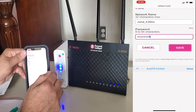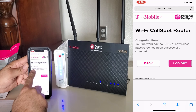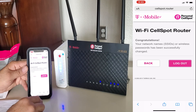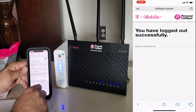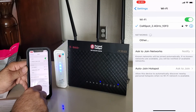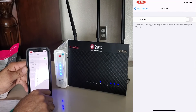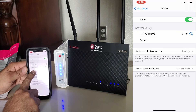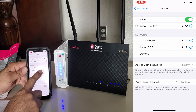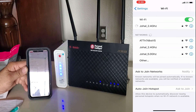We will simply click, and it will ask you to log out. Once you log out, you're done. As you can see, I have changed my network name, password, and I'm going to click Log Out. Now we also have our new login information saved. If you need to log in to your router website again, use the new login credentials you just set. Now simply turn Wi-Fi off and back on, and you will see your new Wi-Fi name and it will connect automatically. If other devices in your house are connected through Wi-Fi, you will need to reconnect them using the new network name and password.